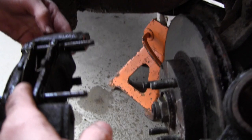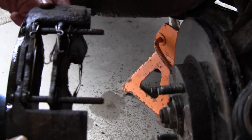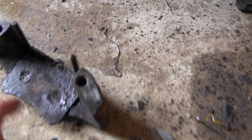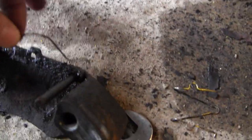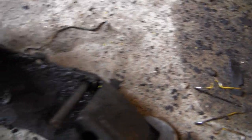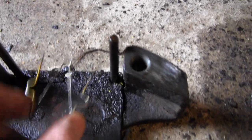We have the two halves separated now, so we can get the brake pads out — they're held in with pins, so we can slide them out and put the new pads in. On these brakes, in order to get the inner pad out, you have to remove a clip that goes into the little holes on each side and holds the brake pad from moving. There's also another clip in between the two pads you have to remove. With the kit I have, those clips don't come included, so you have to keep those — be careful with them.